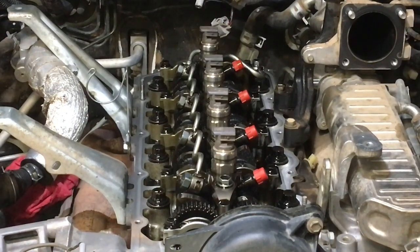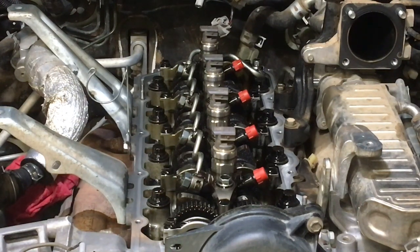They've hit it with their heavy duty gun. It's meant to be 5 Newton meters. I don't care if it's 8 or 10, but 20, 30 and 40 doesn't work. The bolt gets locked into the alloy, and then when we go to undo it, it just spins in the valve cover.